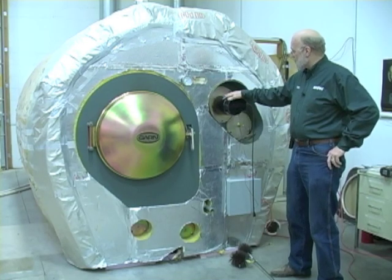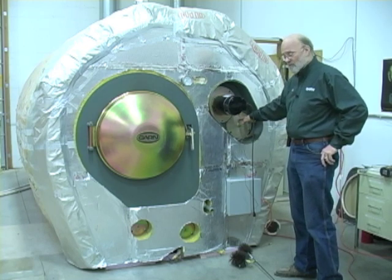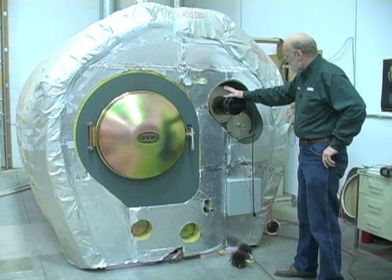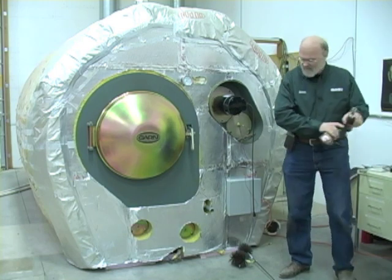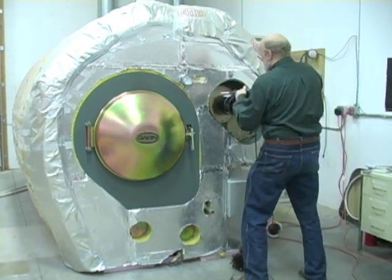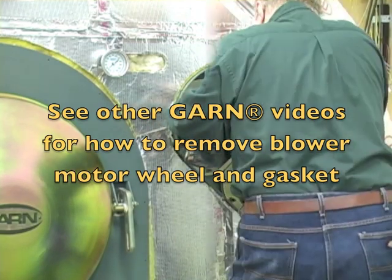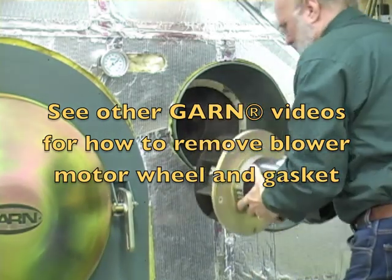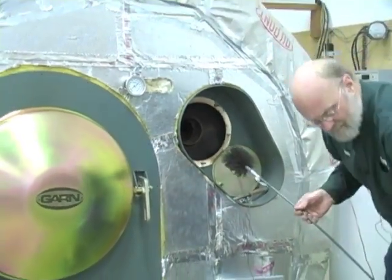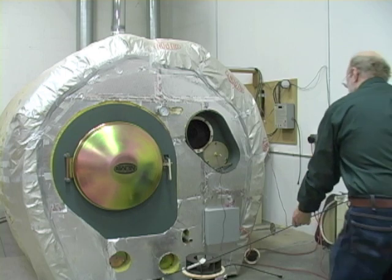In this segment we're going to do the motor tube, which uses a 4-inch brush, and then the last run on the unit uses a 5-inch brush. You then use conventional flue cleaning materials to do whatever your Class A chimney flue is — usually they're 6 or 8 inch. To remove this I use a power drill. First you disconnect the motor and the sensor from the controller so everything is disconnected. I always leave the top nuts last so that it holds the motor in place. We're going to put the 4-inch brush through this clean-out, and that's all there is to that one.